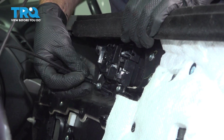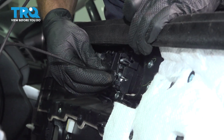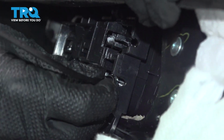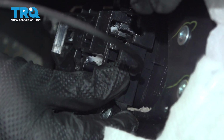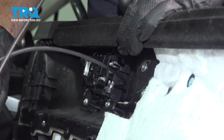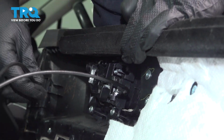We'll use the one with the black connector at the top there, or adapter. We're going to take that, slide it into the door handle down along the bottom there. Now I'm going to pivot this in. We can see a groove where it needs to fit. Press it in, listen for a click. After that audible click, you need to give it a tug, confirming it's secured. You don't want this falling out.